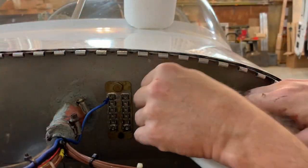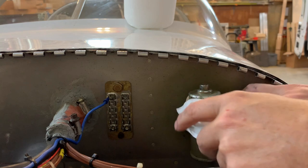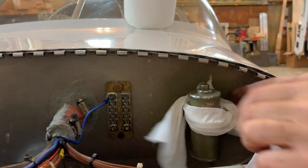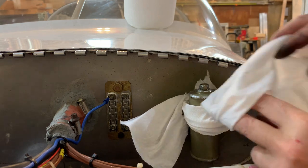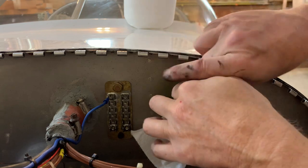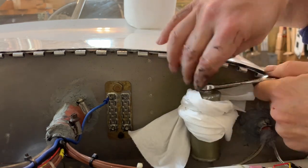Now in a moment I'll have to compress the brake caliper piston, as the new pads are thicker than the worn ones that were removed. While I compress the piston, there is a chance that the excess brake fluid may overflow in the reservoir. So I'm wrapping the brake reservoir with absorbent paper, just in case this happens.